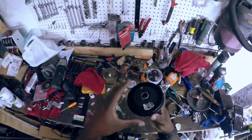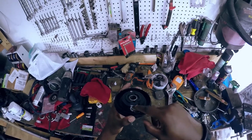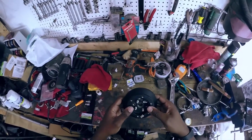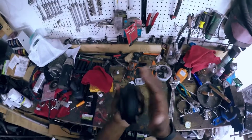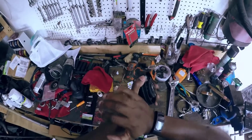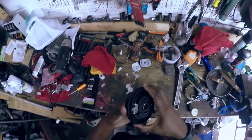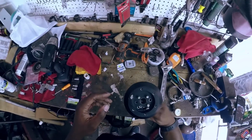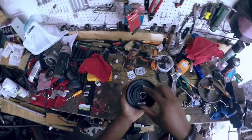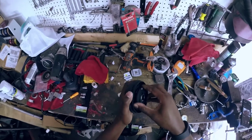You know, the crevice that this sits in is machined flat. The little hub is also machined flat, so it's a real nice tight flat surface, so those 2 surfaces torqued down against each other is what's actually going to absorb that rotational torque. So I think that's pretty sturdy. I went ahead and took this plastic piece off the steering wheel, just plopped it on, sunk a little screw in there to keep it in place and keep it tight.